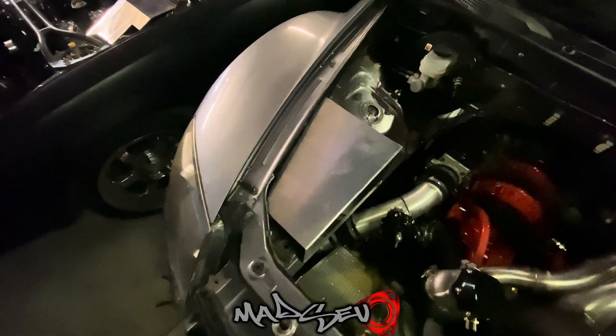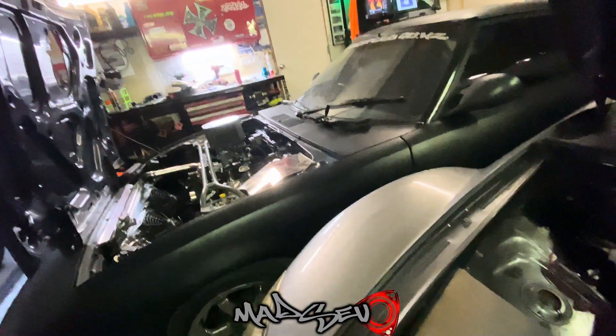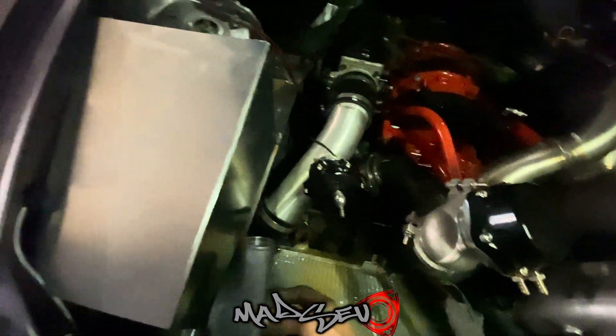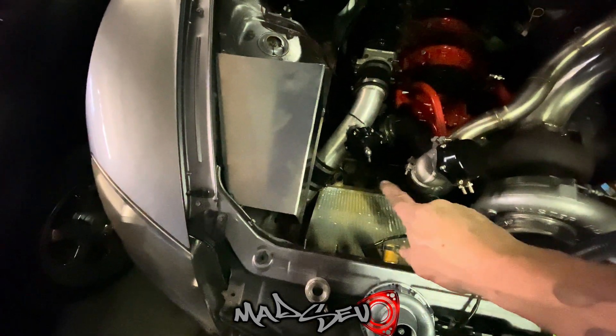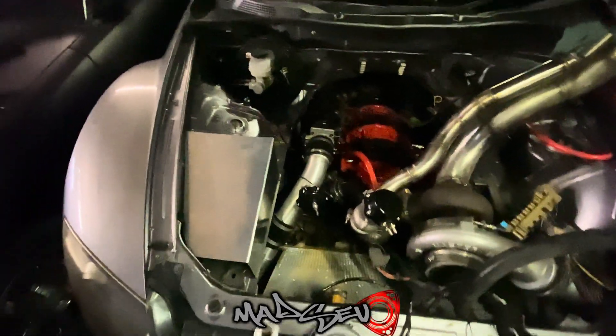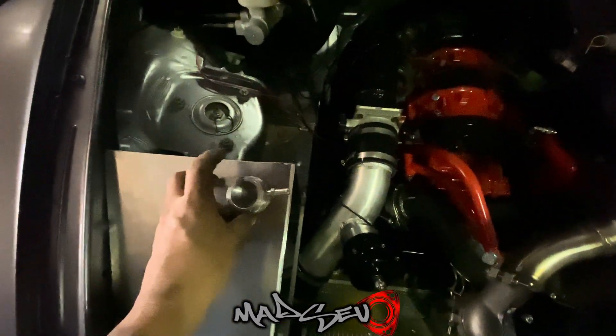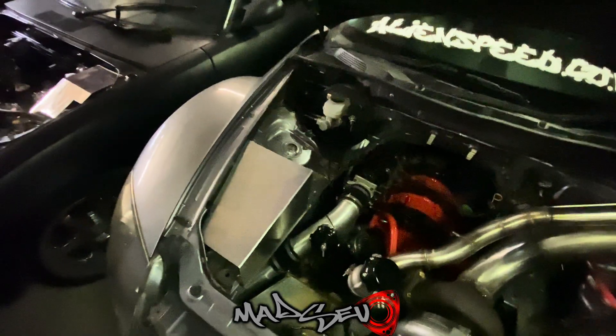So this is where I'm up to now - I'm not in love of it but it will work. This is just the outer shell and I need to build the bits and pieces underneath to make it a compartment. The idea for the water pump is to sit down here like so - sit it down there so it's sitting lower than my water level, which should be good to prime. The cap I'm probably just going to weld off the back like so - otherwise on this angle going down it's going to look ugly. I'll just run the overflow down and out in the wheel arch.